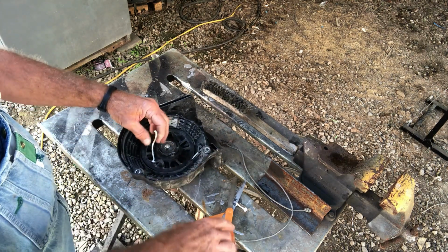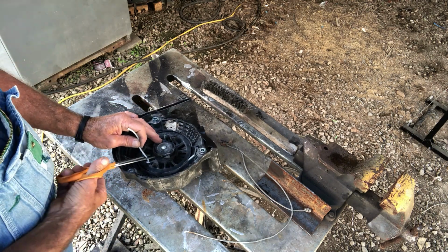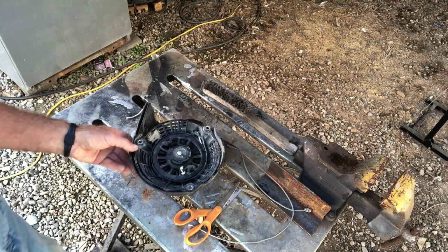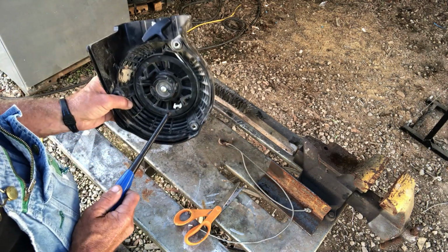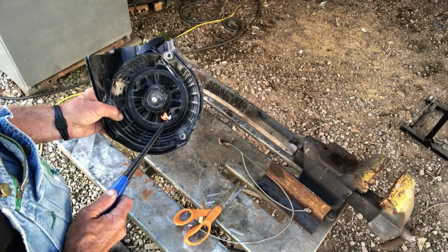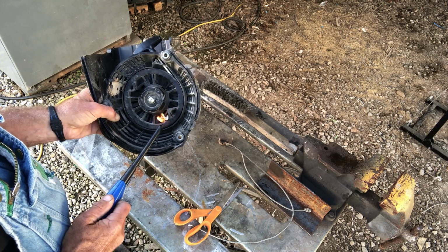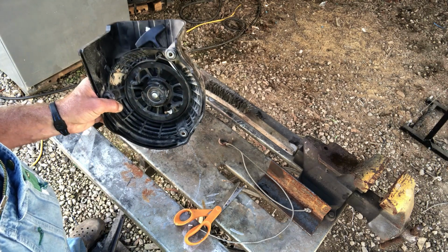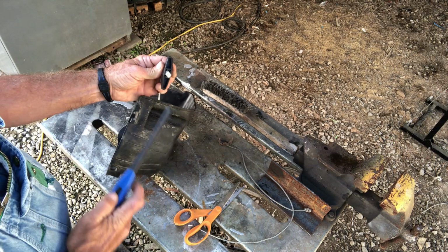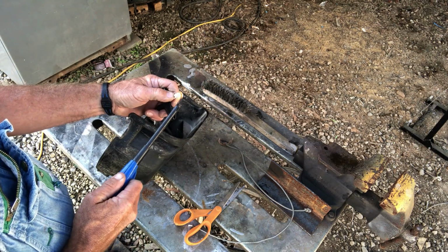Now this extra cord hanging out right here, I'm going to leave it sticking up about a 1/2 inch and I'm going to cut it. And then I'm going to take a lighter and melt the end of that string. So let me go get my lighter. So now I'm going to just melt the end of that string, and that'll keep that knot from coming undone. Now don't reach down there and grab that right now, because that nylon string right there will stick to you and sure enough make a blister. And then I'm going to burn the end of this one the same way.